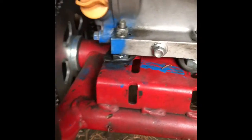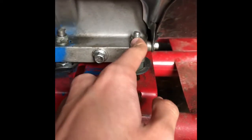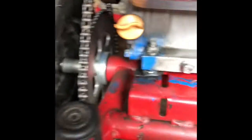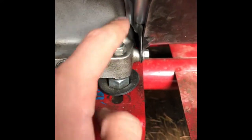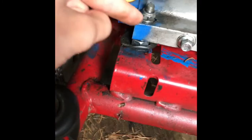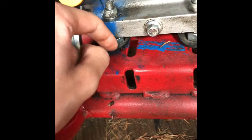What I did was I took the engine and I was able to reuse the same bolts that bolted the 80cc engine down to the frame — they were perfect for this engine too. I used two original mounting holes for the original engine, bolted this through, and it's also on the back. I used two original holes and drilled two new holes on here and on the other side. I put these rubber things to help with vibration — I don't even know if they really help, but who knows.